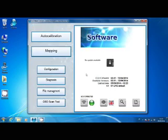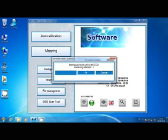So from this point, every time you connect to the locked ECU, you will be prompted to enter the password, and you have just 3 attempts. So if I disconnect and reconnect, it takes a little bit. Okay, now we have to enter the password. You have 3 attempts. However, don't worry, if all 3 attempts fail, you will simply get disconnected from the ECU, and retrying the connection will prompt you again to enter the password. So don't worry about it.